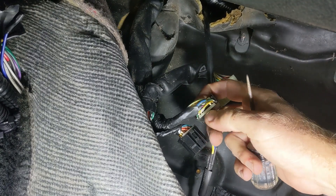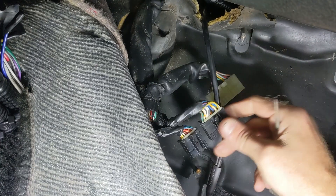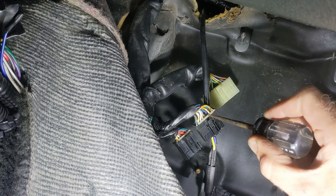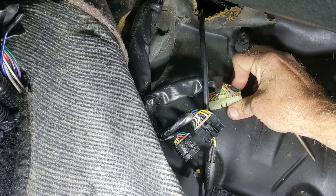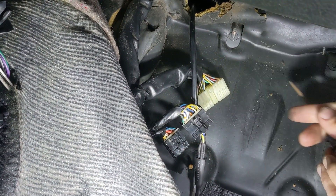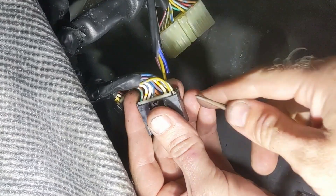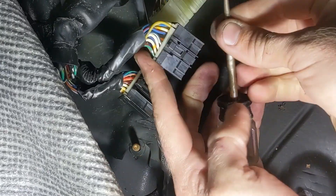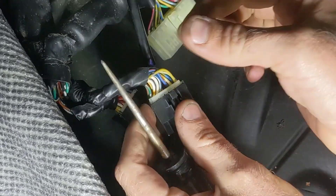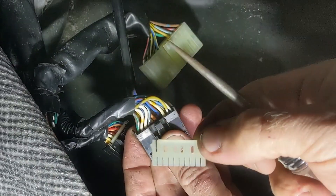You may need to watch another video on learning how to de-pin these things to build your wiring harness, but the B and C ones are the most difficult because they have these little white retaining clips that have to be removed before you can even plug something in. The A plug is a little bit easier — you can actually just plug something directly into the back of the A plug. We're going to need to remove the top of the B plug, which is the medium-sized plug. You can get these white clips off by using a pick tool or a knife and pushing in the little tabs on the left and right-hand side and push out, and then this clip lifts out like this. Set this aside and don't forget to reinstall this when you're done.